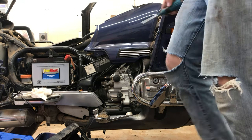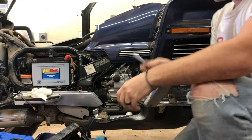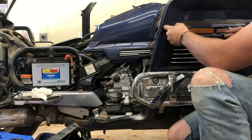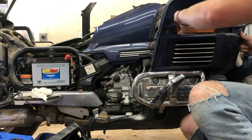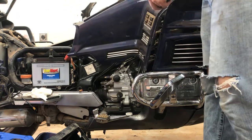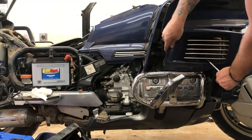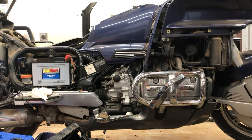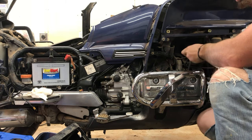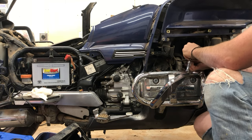The advantage of a hydraulic lifter is that oil isn't compressible, so it can take out any of the slack of the engine. By oil filling these hydraulic lifters, whenever pressure is applied to them, the liquid doesn't compress, so it holds tension, if that makes sense. So there's pretty much 12 of these on this motorcycle. There's one for each, like I said, intake and exhaust valve.